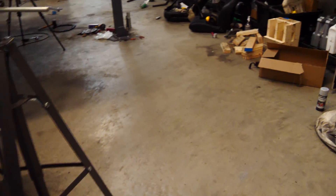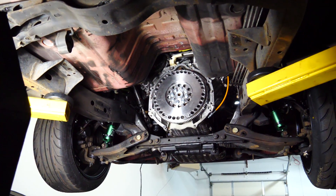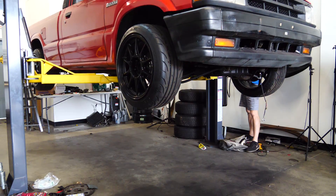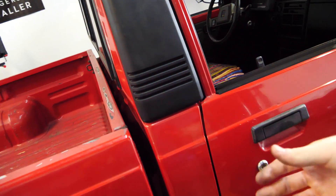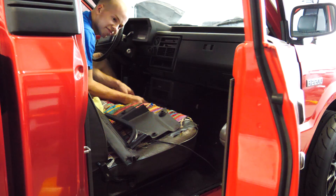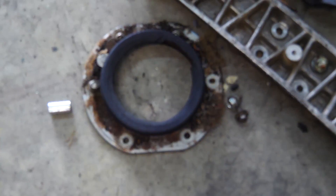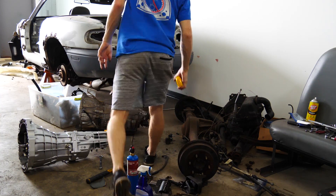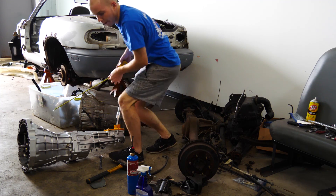The good news is once we get the right bolts and get the threads fixed on the block, it's going to be awesome. The flywheel and the clutch were all really good, and the transmission is going to fit in here perfectly. It just stinks that I can't do anything else now. While I'm here, I'm going to go ahead and cut a bigger hole in the trans tunnel for the shifter. The old transmission is about 28 inches bell housing to shifter; the new transmission is 33 inches. So we have to cut five more inches out.